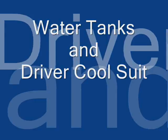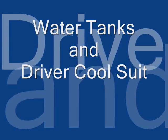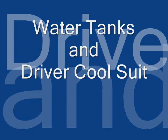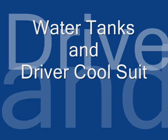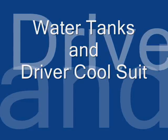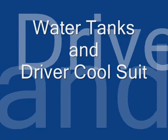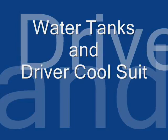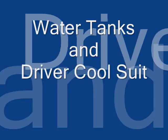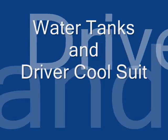We can't carry a radiator in the car, so we have water tanks. One water tank supplies water strictly for the engine, and we maintain a certain temperature. We also have another water tank for the intercooler, which is a device between the intake manifold and the supercharger. When fuel comes through into the supercharger from the injector, we keep it at a cool temperature so combustion is extremely efficient, giving us good clean combustion without pre-ignition or detonation.